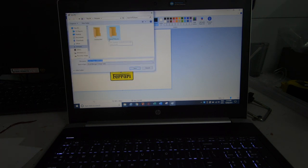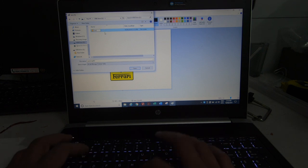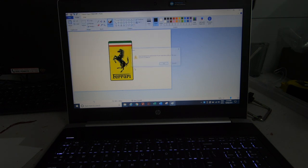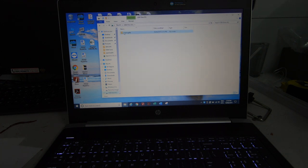Go to File, Save As, BMP picture — very important. Name it 'opening file'. Now go over to the USB and create a new folder — the folder also needs to be called 'opening file'. Open that folder and save your BMP file inside it. So the structure is: USB drive → folder called 'opening file' → BMP file called 'opening file'. It doesn't matter what picture you use as long as you resize it to 800 by 480 first.